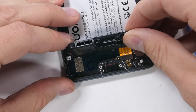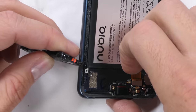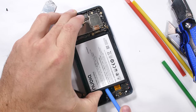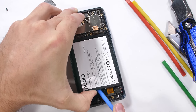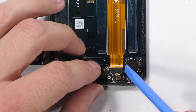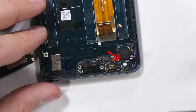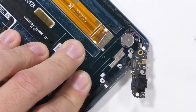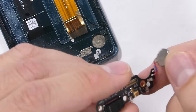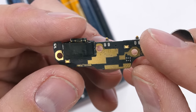The plastic loudspeaker can't quite pull away on its own yet though — it has one of those black wire cables built in going all the way up to the top motherboard. The large silver internal battery has no magic pull tabs; it's one of those permanent pry-it-out-and-hope-it-doesn't-explode style batteries, but the adhesive isn't too bad this time around. It's a pretty big 3800 milliamp-hour battery. The charging port has one gold ribbon connector, a single black wire cable, and one tiny silver screw holding it in place. After that the whole thing can lift up and pull away from the phone along with its large coin-style vibration motor that's soldered onto the board. It's got a little circular white water damage indicator — this phone is not water resistant. And of course we have the USB-C port down here as well.